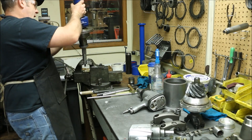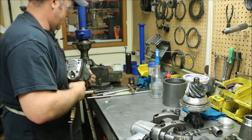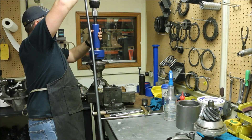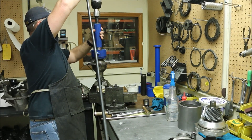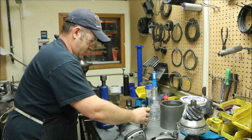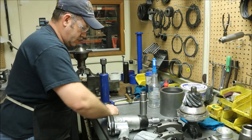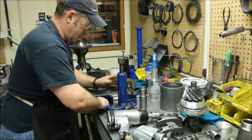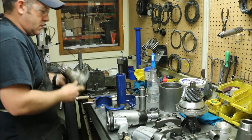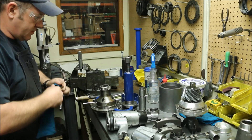Put a little bit of tension on it. I use a stub axle to hold the other side. When you pull it back apart, the bearing comes out as an assembly — it doesn't get damaged, you don't have to beat on it. A lot of times the problems that arise whenever people want to reuse bearings is because they're damaged when they switch them from one carrier to another.